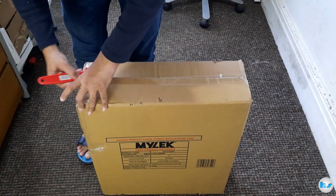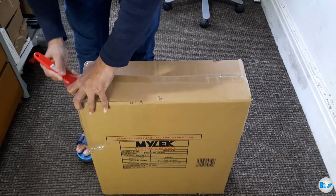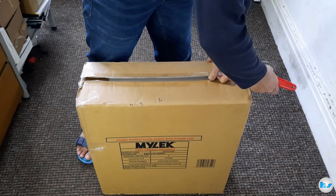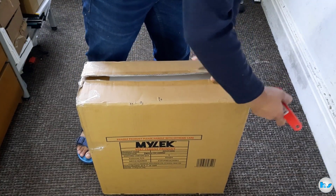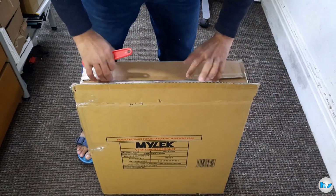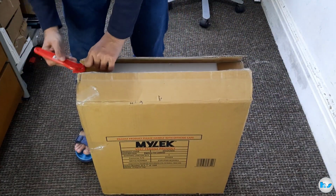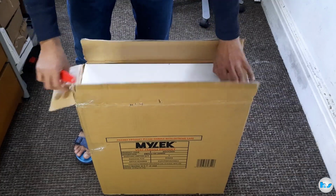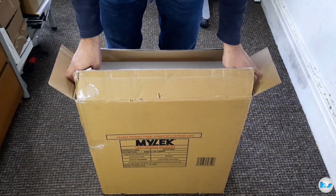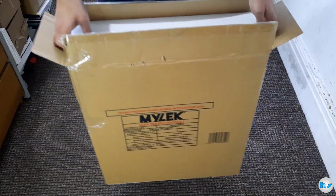The radiator has 3 heat settings, which are 0.8 kilowatt or 800 watts, 1.2 kilowatt or 1200 watts, or 2 kilowatt or 2000 watts. It's powerful enough to heat a room size of up to 23 to 28 square meters. It's got an easy to use thermostat, easy to switch, but I will go over those details in a minute.